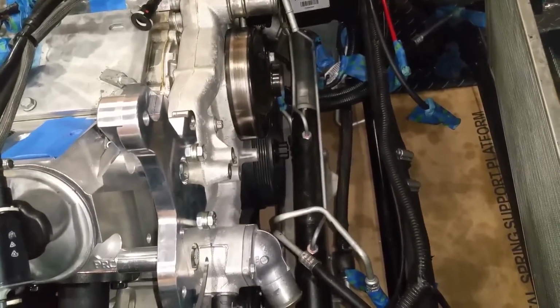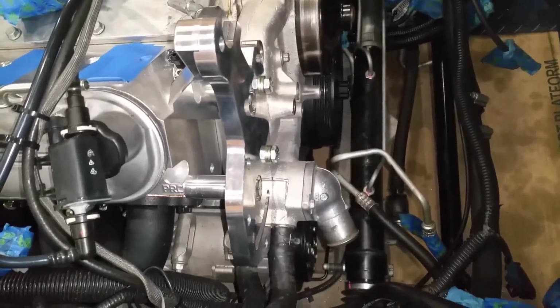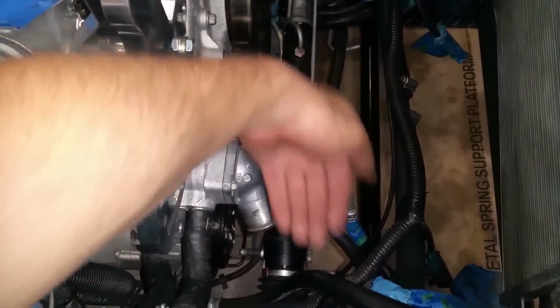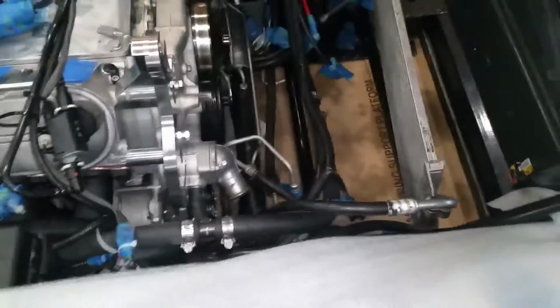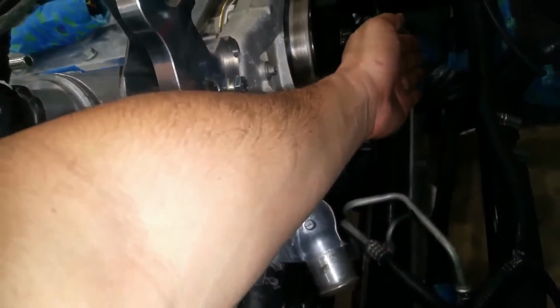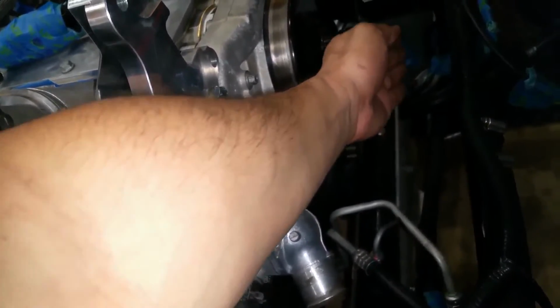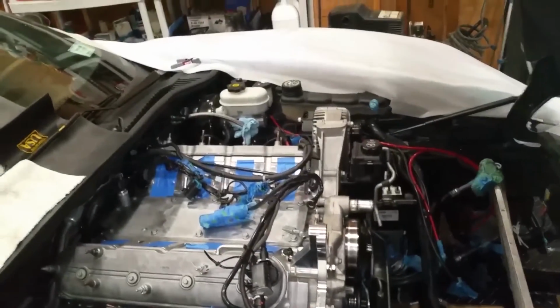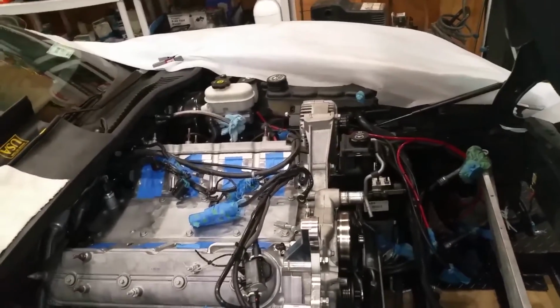And then the other problem is that the way the Procharger is set up with the piping that it comes with, the down pipe just goes straight down, then you got a 90, and then it loops into the intercooler over here. But the way the A&A Corvette Procharger Bracket is set up, it's now got the bracket, the outlet on the supercharger coming out at like, what is this, a 135-degree angle instead of straight down, which means I have to get different piping, change things around.